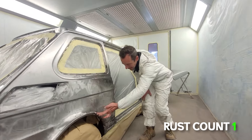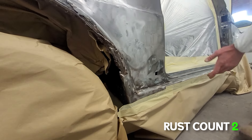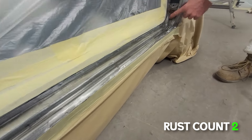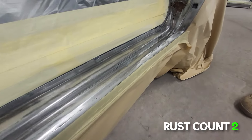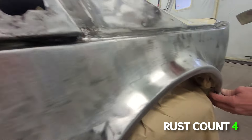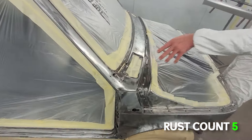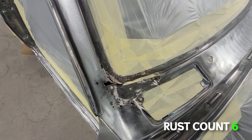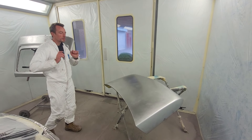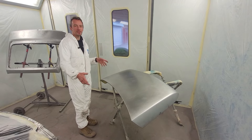This rear arch is really bad. Underneath the masking there are plates the whole length of the sill — you can see it's welded all across the top. We've got holes just underneath the hinges, rust in the front piece, rust on the front lip — though that's quite an easy repair. Also the bottom of the windscreen, both sides — that's gone and will need a full skin of filler. We're going to put a high-build epoxy primer on now; once we block that back it'll get a lot of the shimmers out, but it'll probably still need a skim of filler just to surface it and get it nice and smooth.